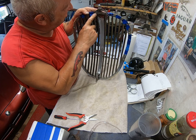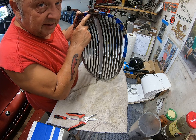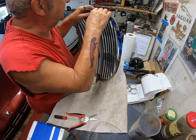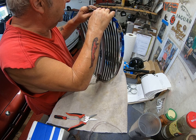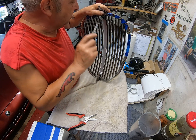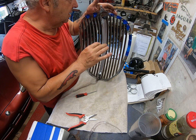Now, it could be that these screws are bottoming because they're quite long, 1/2 inch. Hey, my wife thinks that's long. So maybe I'll bring them down. Yeah, I can bring those in a little more. I'm just giving it a squeeze right now, but no, the screw won't turn anymore. So I'm going to have to grind these down just a little bit.